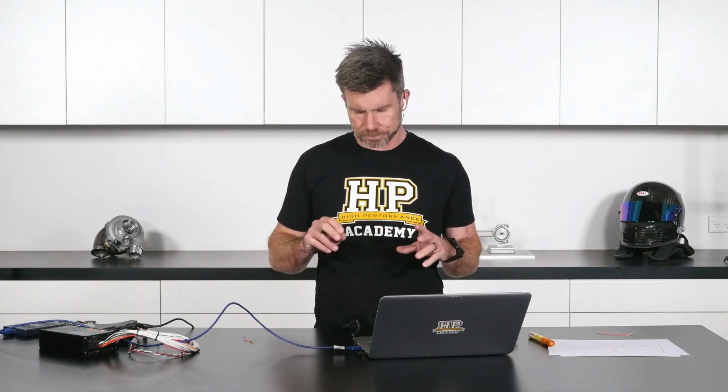Basically, it's just going to depend on the ECU header plug that you're working with and basically what is physically possible. We don't really want to be cutting through the insulation on our wires and accessing them in that way. That's definitely not something I would recommend doing. It's always best to actually extract the terminal out of the header plug and then go about it that way. It's only going to be temporary, and then you can revert everything to how it was.